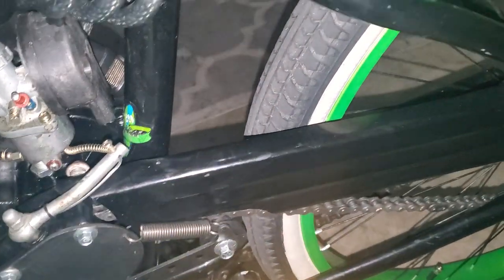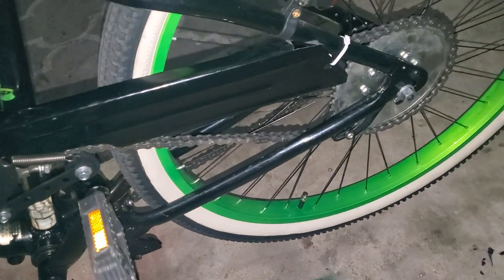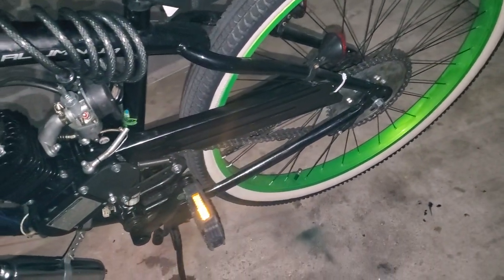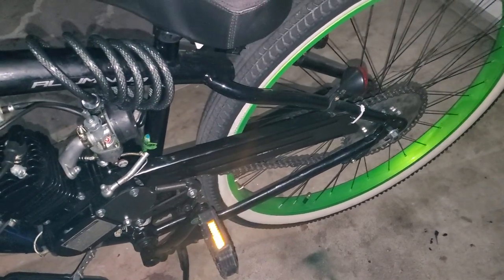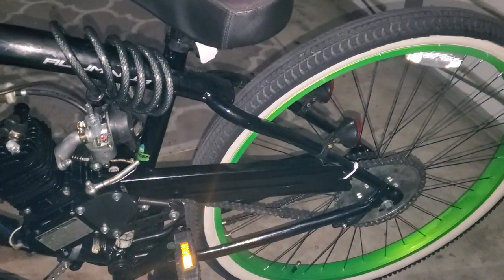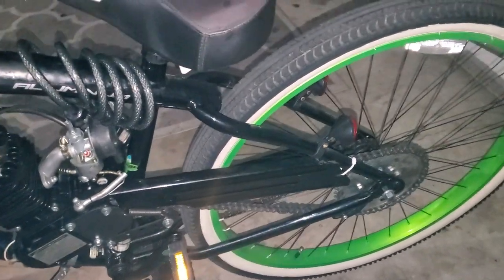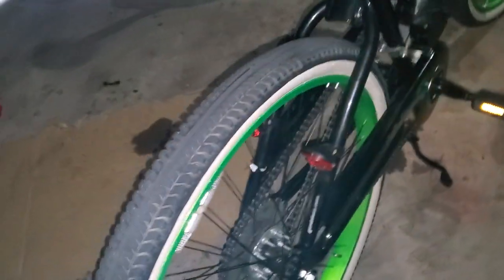Here's your tensioner, by the way. You might notice a little bit of a slap now when you release that clutch lever to engage the clutch — it's kind of a slap because it's more flexible down there as that spring's working when you first go to engage the clutch. So just keep that in mind. Get a good speed up, start pedaling fast, and you'll get a feel for it.